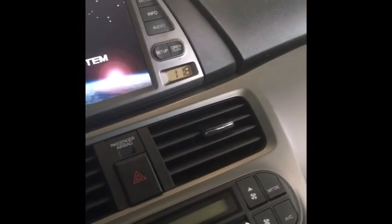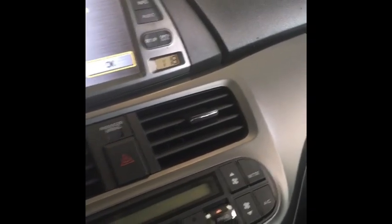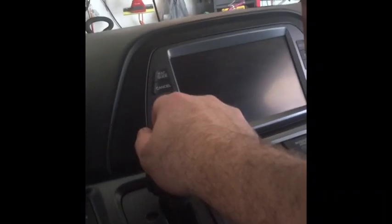Yeah, there's the time, 1:18. It's been 5 minutes, so what we do now is stick your foot on the brake, and we cycle through all the gears here. Keep the emergency brake on and the foot on your brake.